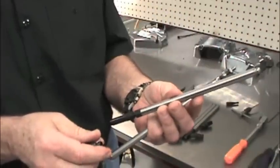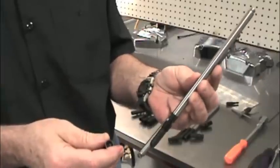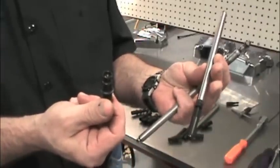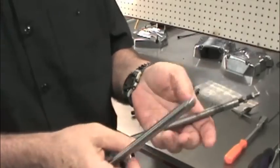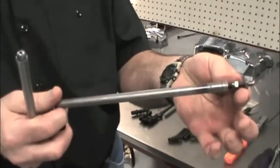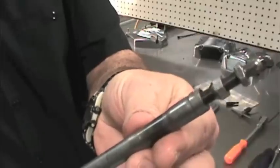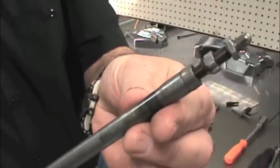If you're running a high lift cam and aftermarket valve springs, I'd recommend one of the S&S pushrod kits. For less demanding applications, the adapters and stock pushrods should work alright, as long as your stock pushrods are in good shape. However, any stock shovel pushrods are at least 30 years old, and a lot of them are pretty messed up.